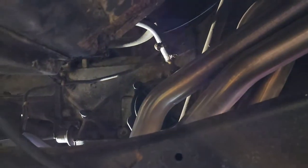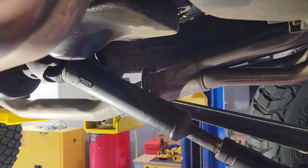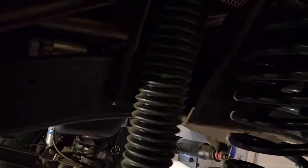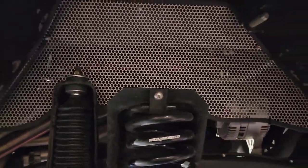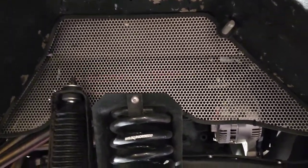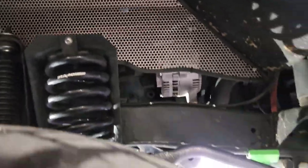I've got to clean off that differential before I button it up. I got a mini high torque starter on it, headers. Stock C4 tranny. Well, it's a Bronco C4 tranny. They have a little different sump in the bottom. You see that bump sticking down? That's kind of for off-road, but it also keeps oil down at the pickup. Bilstein shocks on it. Does pretty good. Got these little grills that cover the side of the motor, and it's open. It lets it breathe a little better. Somebody had already cut out the fender well, so I just added these grills to it.